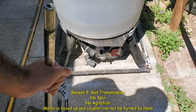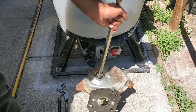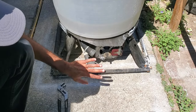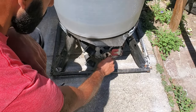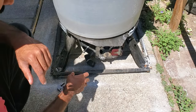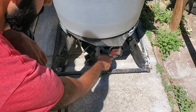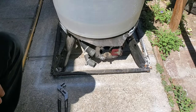The eighth reason — also an unlikely reason — is that the transmission is bad. This is what a transmission on a direct-drive washer looks like. To test this, if everything else is okay — meaning the coupler and the motor are okay — you should be able to freely spin the motor shaft in either direction. You should be able to turn it just fine. In this case the coupler is broken, so it won't be a good indication, but if the coupler was okay you should still be able to turn it in either direction.